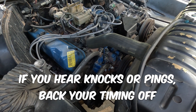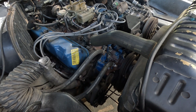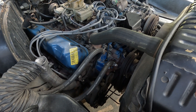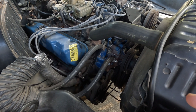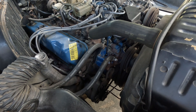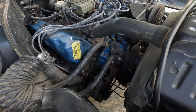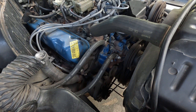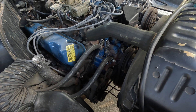Generally speaking, 32 to 34 degrees is about the top of your timing that you want, and that should come in somewhere around 3000 to 3500 RPM. Mine may have gone a little higher if I'd revved it more, but it went to at least 32, so I know it's close enough. It's been running well so I'm not going to try advancing it.